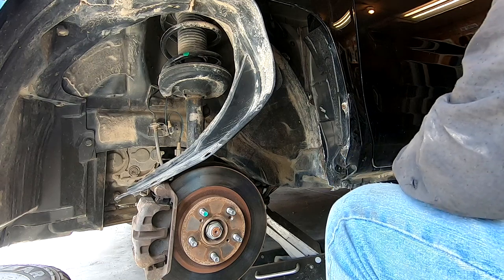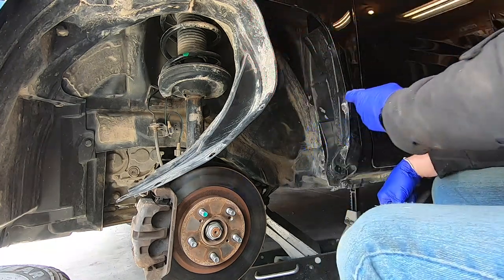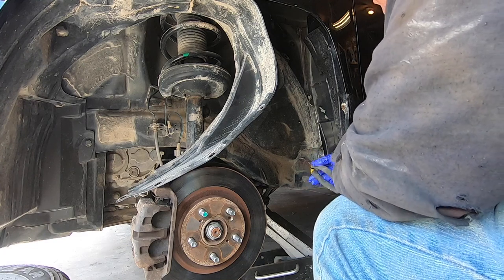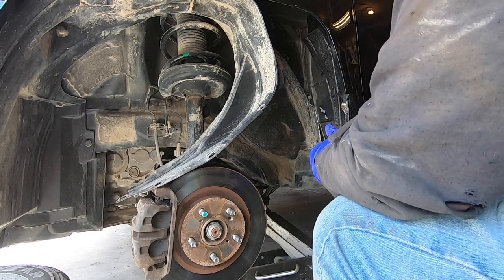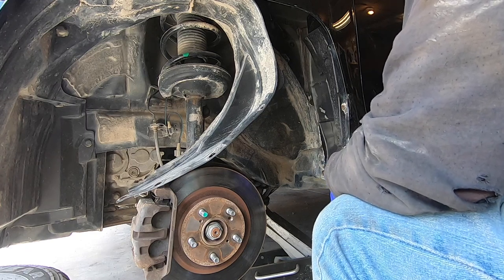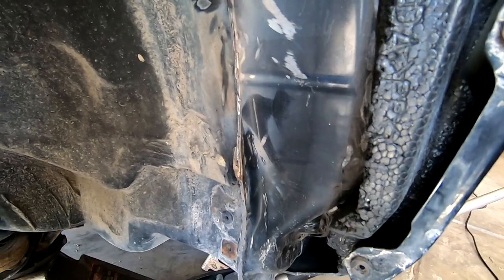You can see what I've taken off here. Even though everything looks okay, you still broke the welds where two pieces of metal came together. So I'm going to take my MIG welder and tack it in a few spots right through here so you don't have to worry about it pulling apart. We definitely don't want to harm the structural integrity of the vehicle. Once it's welded up and cleaned up with a flap disc, I'll take some Rust-Oleum paint and coat everything so it doesn't rust.